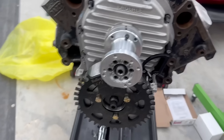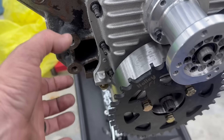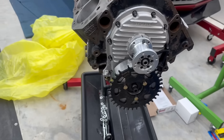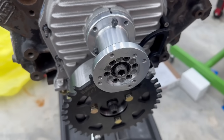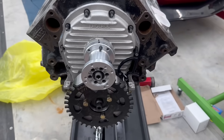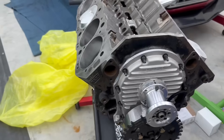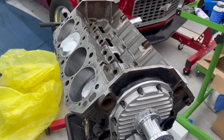That's going to wrap it up. We put the 36-minus-one trigger wheel on here and it fits perfect, but the bracket isn't in the right spot. I'm going to see if I can order just a bracket — if so, I'll be good to go. A lot of people go with the flying magnet 12-minus-one, but I like the 36-minus-one — it's real simple to set up every time. That's how you do top dead center. I'll be heading to get my heads from Mike tomorrow night. Check out uncle Mike's shop on the new Mustang.